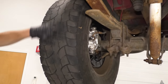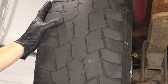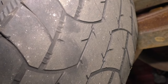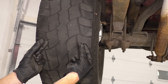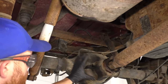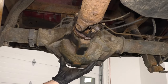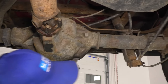Another thing we can look at right here — look at this tire. This isn't in the best condition. Some tires have much more tread sticking out, but you might also notice that they're pretty much chopped up. Some have small layers, some have deep treads, and that's going to cause a vibration as well. If you have weak shocks, that could cause a vibration. There could be an issue inside your differential where things are too loose or too tight, or your wheels could be damaged or out of balance.